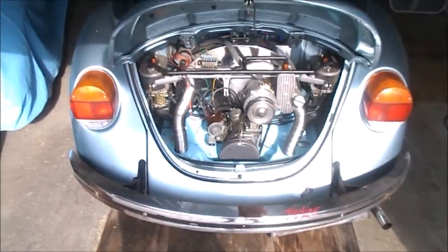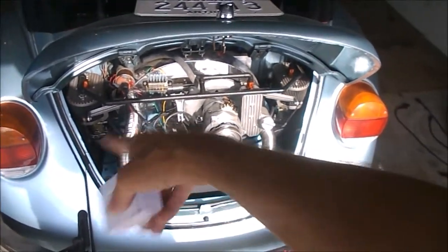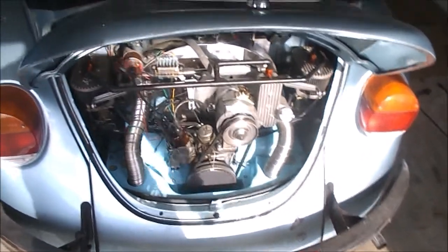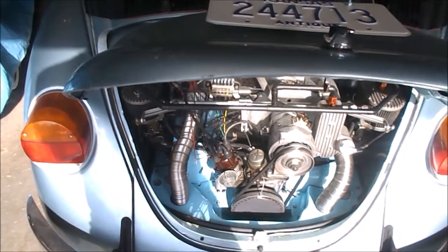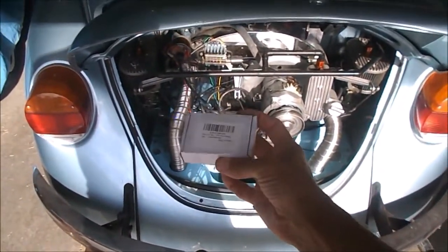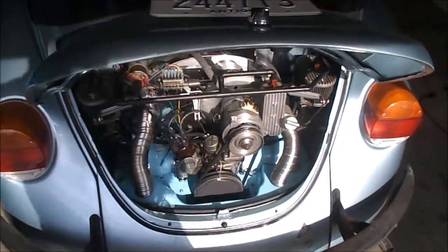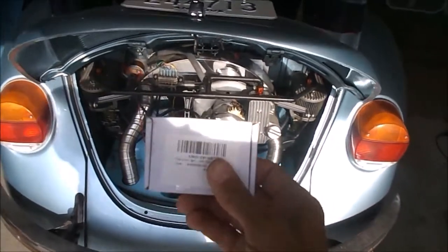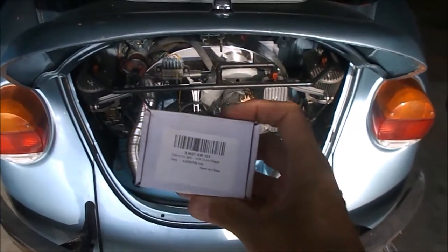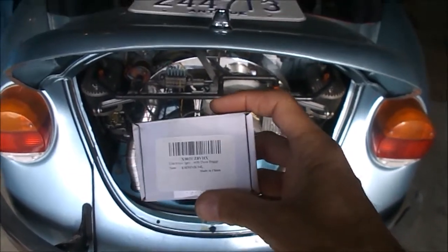I had that nice little electronic ignition in there, and I was playing with my idle trying to get everything balanced out. I think I was right in the middle of twiddling my mixture screw and it cut off. So it is now back in the box — I'm going to send it back to Amazon. It fried. But I did learn what I wanted to learn, which is that it is more accurate to use the CompuFire style. I'm not sure what I'll do next other than put this in a package and send it back.